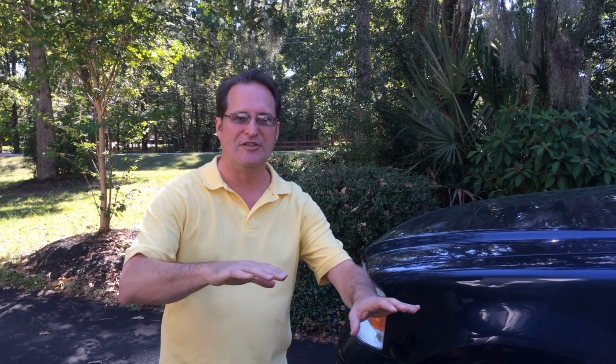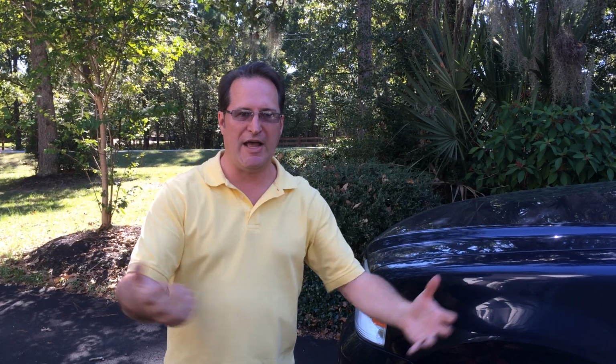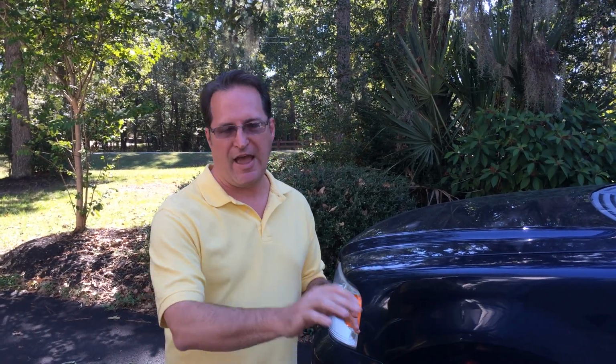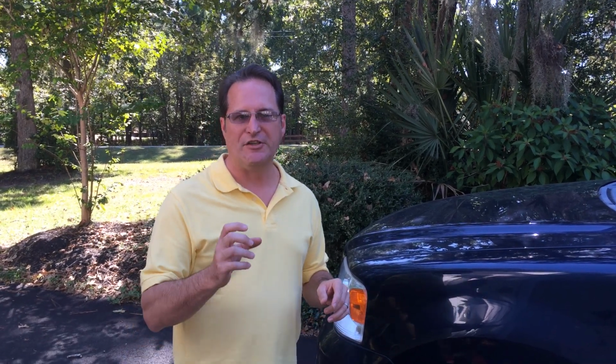So how does the brake rotor get warped? Well, good question. When you're driving on the freeway, that brake rotor is super hot, because the brakes have been riding on the rotor. When it's rainy outside, there's a big puddle of water on the exit ramp of the freeway. You're at 70 miles an hour, stepping on the brake, coasting down to the exit ramp. You hit the puddle and splash nice cold water all over that nice hot brake rotor, and it expands and contracts, expands and contracts. And as you're coming to the final stop sign, you're pushing on the brake. The expansion and contraction, the cold water, and the final stop make that rotor warp. So you can have it trued, or thanks to China, we can replace them.